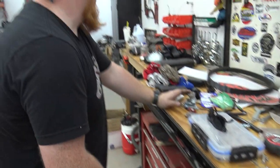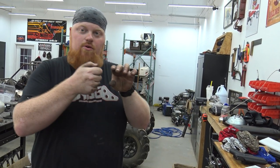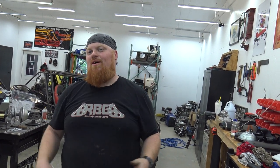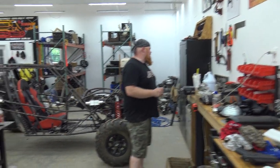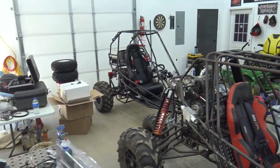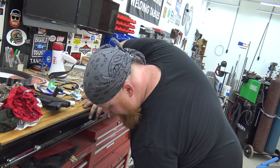I've got a gas valve for a welder. What we could do is hook up a small 12 volt battery, put this gas valve there with the bottle right off of it, so it's a short run - tuck it under the head so it's all hidden. Then we'd basically have a run that long and have an actual electric button. That's what we're doing. We're wasting a lot of time on something that's going to happen for three seconds - I think the bottle will last about eight seconds with the jet that's in it.